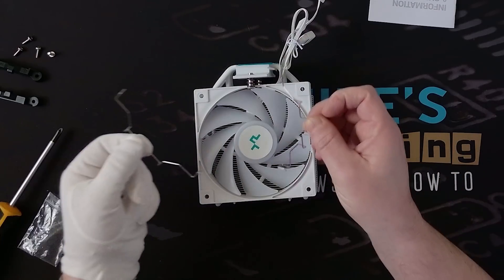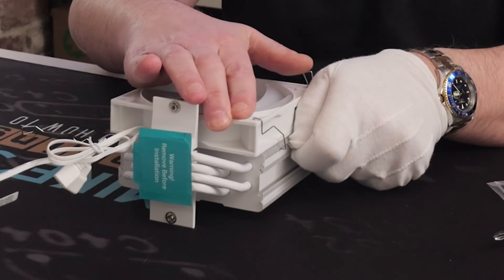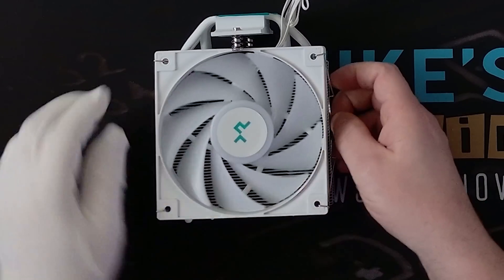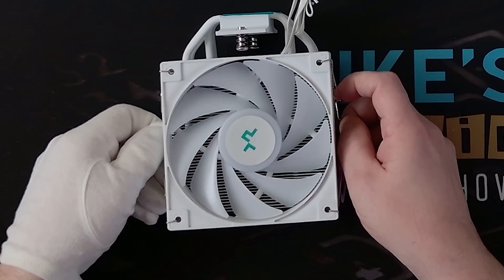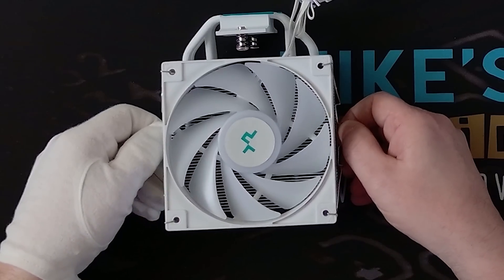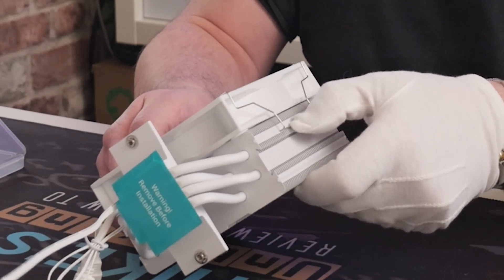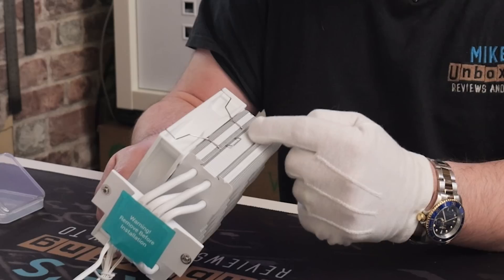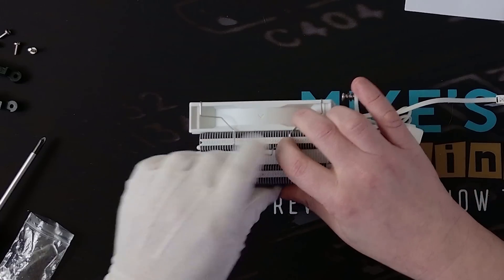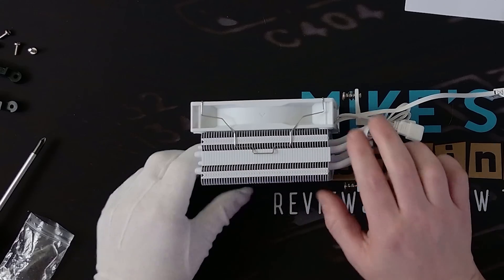I would suggest laying the cooler down on a flat surface so that the fan isn't going to wiggle around too much. Grab your two spring brackets — they've got little hooks which hook into the holes on the fan. Pop one in here and one there, then do exactly the same on the other side. Get it roughly centralized — you can raise it up or lower it depending on your needs and case dimensions. On the sides, where you've got the clips, just pull the clip down until it locks into place. These are very strong spring clips so you might need a little manipulation, but when it locks it should look something like that.